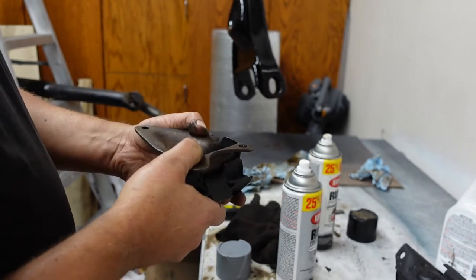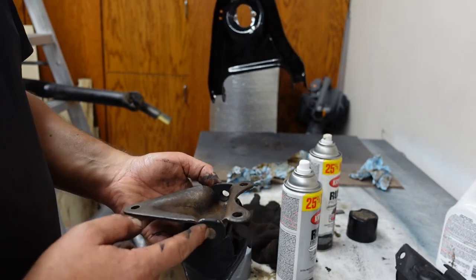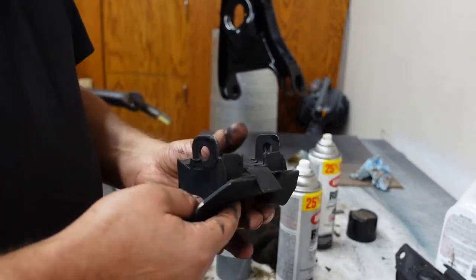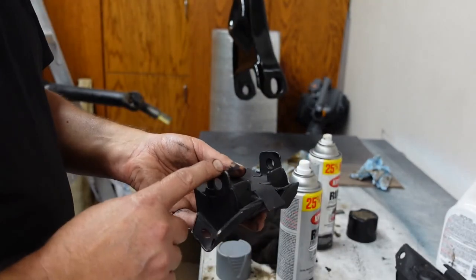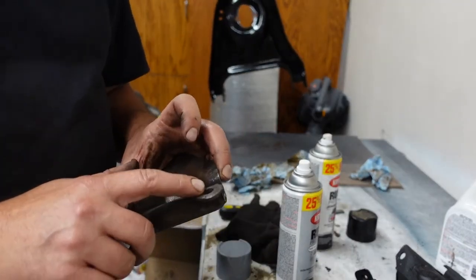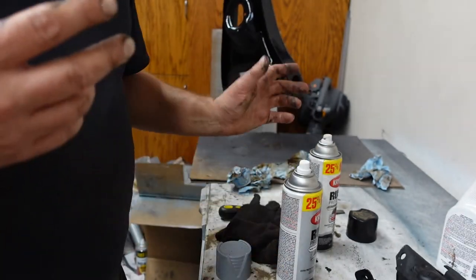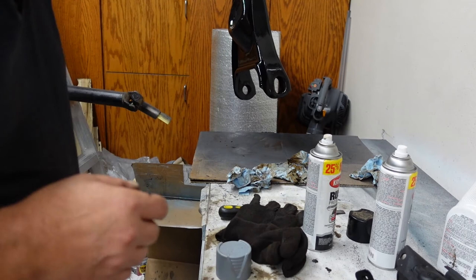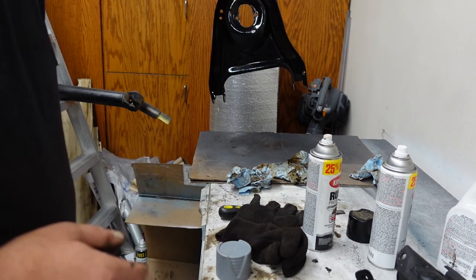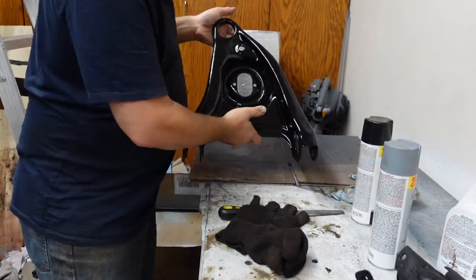Okay. Well, I better go get some. I don't think I have bolts for this. They did not come with these, so I've got to get engine mount. Oh no, I bought those. Actually, I bought the engine mount bolts already. But what I did not buy was bolts for this, so I'm going to go buy some grade 8s to replace the ones that were in the car. It's 53-year-old stuff. I might as well go ahead and replace it. No use in trusting really old hardware. It's got to hold my engine in, so if I'm going to clean that up, I might as well go ahead and replace it.